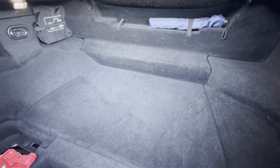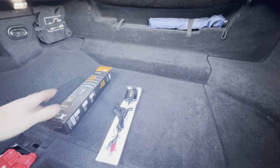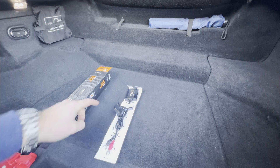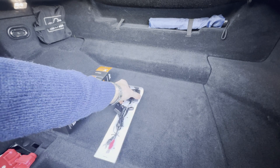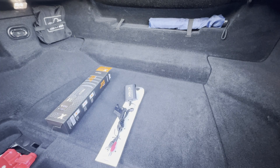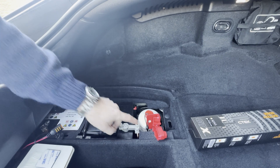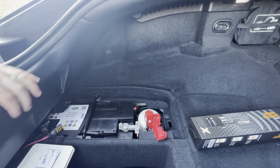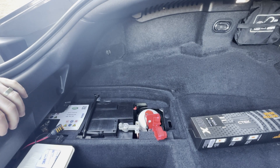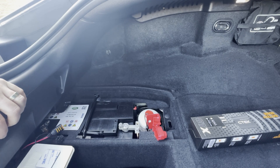The kit is dead easy to install. Two connectors, comes pre-fused already, which then talks to the brain of the device. Two spade connectors — fork connectors, prong connectors — this should go quite nicely under both of the terminals with a 10mm nut. Let's get that on, get the cable routed nicely and out of the way, and get it fired up.